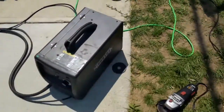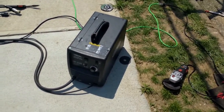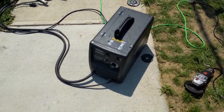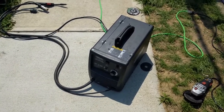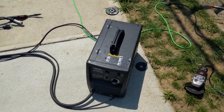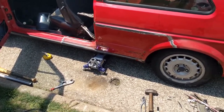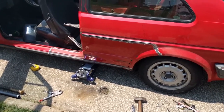I have gotten my cheap little flux core welder. Don't need anything fancy when you're doing sheet metal, because who cares? This thing was cheap. Welds good as long as you use a high-grade flux core wire in it. I think I paid $130 for this stupid little welder. It's only 110 volt, but I used some Hobart flux core wire. It's good stuff. Leaves a pretty nice weld, very little spatter to clean up. Penetrates nicely. Perfect for sheet metal, exhaust, things like that. It'll be perfect for putting this back together. We will see you in the next update.